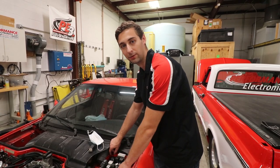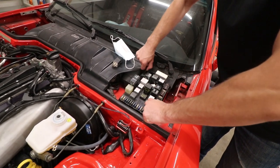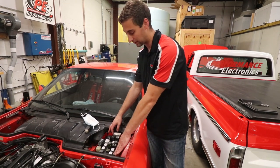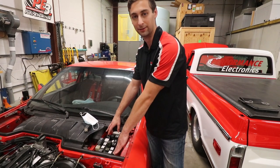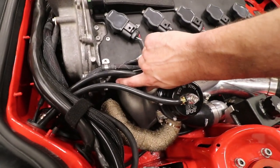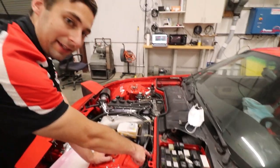To tie in your main 12-volt power, unscrew the two knobs and pull up the power distribution module, then install the main power underneath. Before unscrewing those terminals or moving the fuse box, make sure the main battery is unhooked. Your main ECU ground connects to the head on the 944, or elsewhere on other applications. The smaller gauge ground wire in your harness goes to pin 3 on the 944.